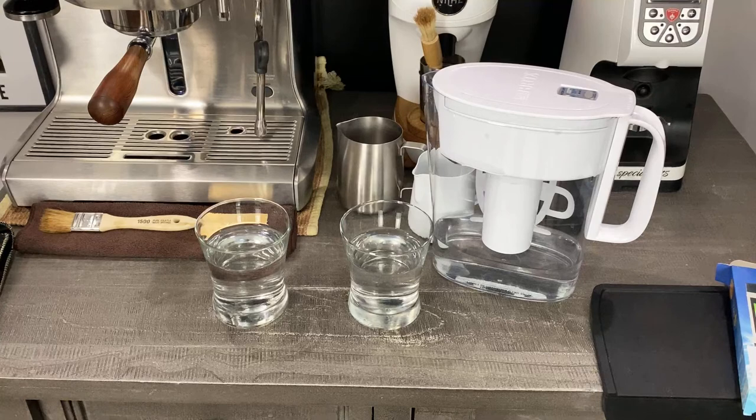they run based on heating up elements inside of any machine. Right now we were talking about the espresso machine. It could cause scale buildup. And if you don't descale your machine as often as you should, and you don't backflush as often as you should, and you are using water like what I am using with the Brita filter, it could damage your machine without you maybe even being aware of it.